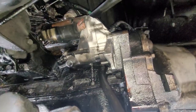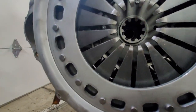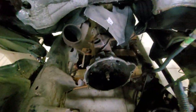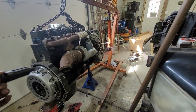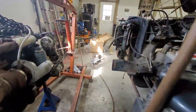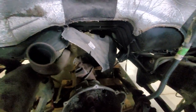There you go — look at that little spacer, that's what you need to purchase. Once you tighten all the bolts, make sure this guy slides in and out fairly easily — you want it centered in there. You're gonna throw a lot of grease on the end of that before you throw it in. In this case we're gonna throw the engine in first because it's easier to line up — we've got to take the motor mounts off, so it's actually easier to put the engine in, throw the motor mounts on, line it all up, then line the transmission up when we're throwing it in.